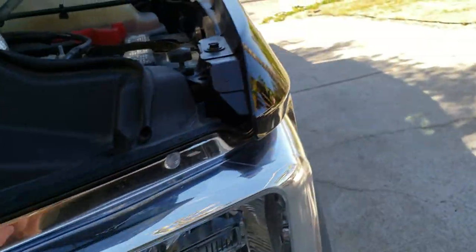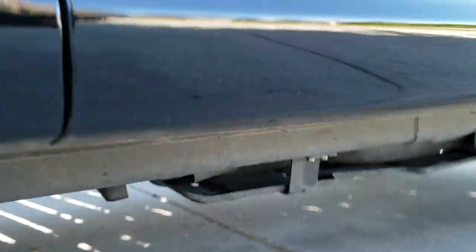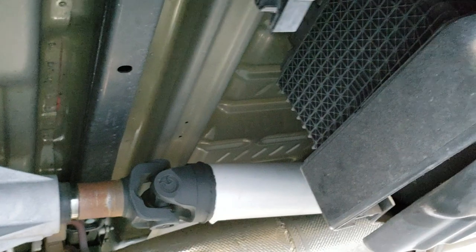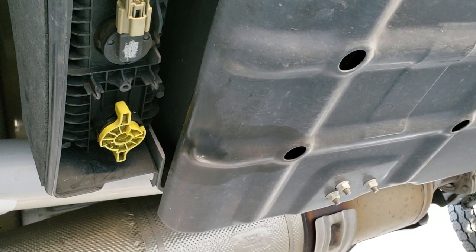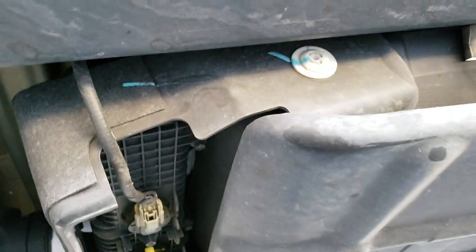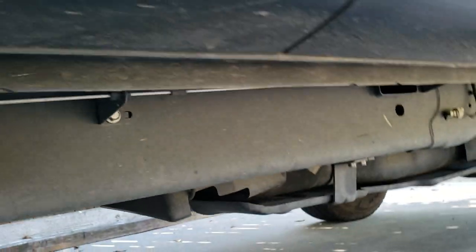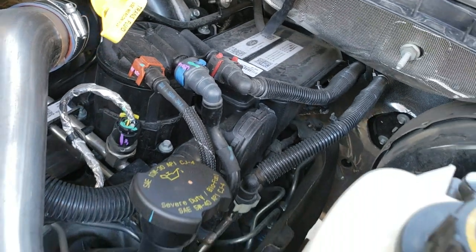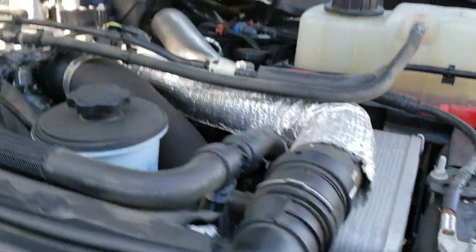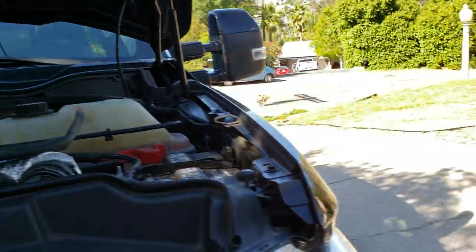So what I did — like everyone should do every once in a while — I came over here. There are plenty of videos online on how to do this. I'd already changed both of my fuel filters: this front one, the main filter for the water separator, and also this filter right here — that's your last filter before fuel hits your injectors and fuel rail.